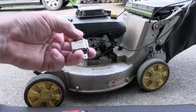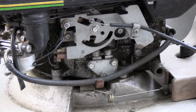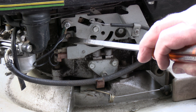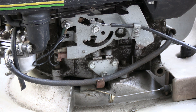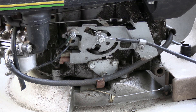It's an igniter. The one that I'm replacing is this one right here — it's behind this plate. I'm going to take that plate, drop it down, and go ahead and replace the one that's on there. I'm going to remove this bolt and this bolt here; those are 10 millimeter bolts, and once that second bolt is removed it will fall off. Be careful, you've got a couple of linkages as well.